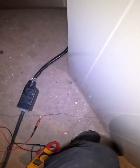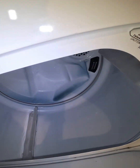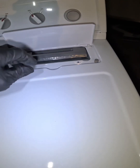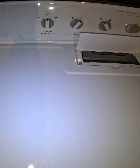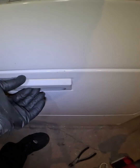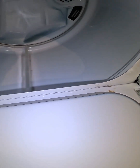Now we're going to plug it back in. Our switch will no longer work, but the dryer should come on. Looks like something was caught in the lower wheel, but the dryer is working. Of course, your dryer will now run with the door open — if I press Start right now with the door open, the dryer will work. So be careful.